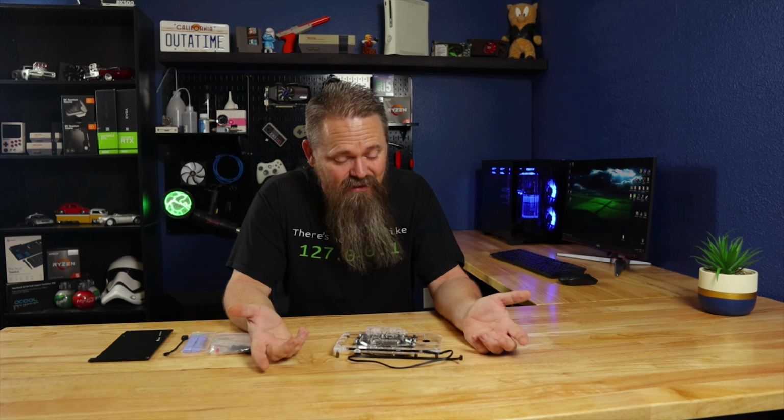Now, keep in mind, you still have to have all the other cooling components in your loop, which does make it bigger, but those pieces can be arranged in different areas of the case. So if you have a really compact system that you want to not only be really quiet, but also have a lot of performance, then it's hard to beat water cooling. Keep in mind, the 3070 that I was speaking about before is a full-length card, while the 3060 in this system is much shorter. In fact, without modifying my loop, a full-length graphics card wouldn't even fit in this case. The pump and reservoir are mounted right in the way of a full-length graphics card.